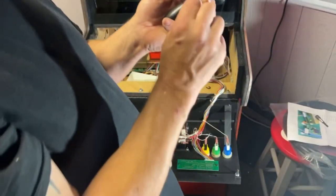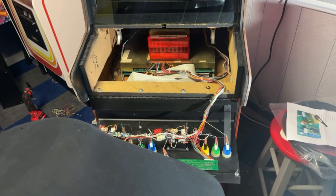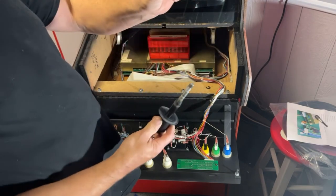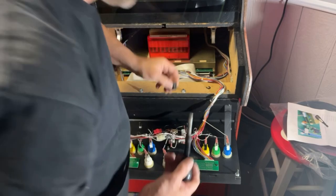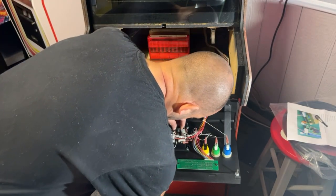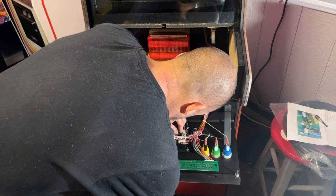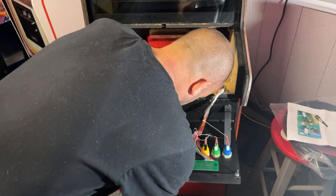So I put my washer on, the sleeve is on. We have these that have to go on. These go on first, and then we slide it up through, and then this is our actuator. The fat side, I believe, makes it four-way. The skinny side makes it eight-way, I believe, or I could be backwards on that. I'm gonna check before I put that E-clip on there. Nope, other way around. The fat side makes it an eight-way, because then you can hit both switches at the same time.